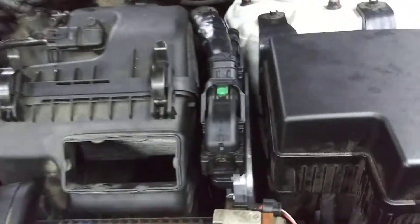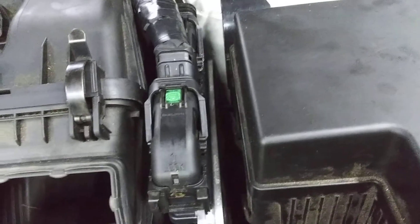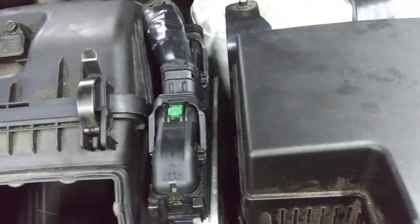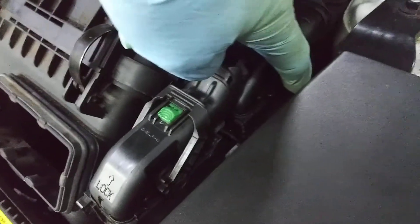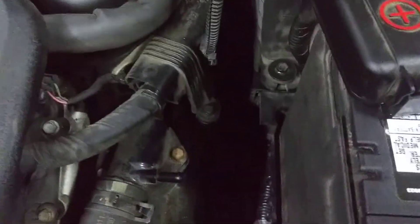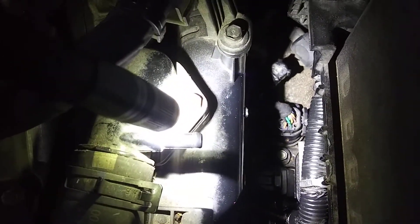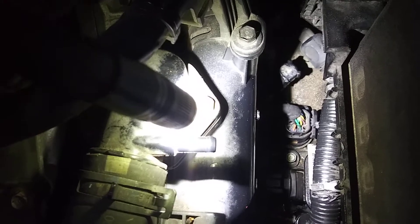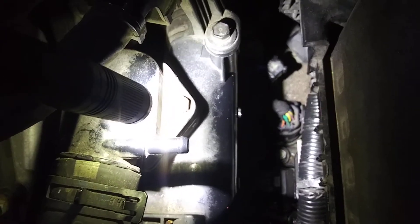So what do we have to do to fix this thing? This is a Sorento model. What we're looking at here is the battery, and behind the battery is the engine and transmission control module — they put them in one box. On this module you have connector A in the back and connector B. This module sends power down to the transmission solenoids. The transmission is located below the battery and gets its power into that connector right there. There are two power sources: a green wire and an orange wire to the left of the green one — these power up the transmission solenoids.